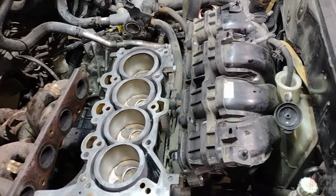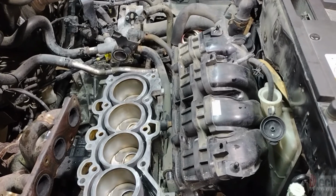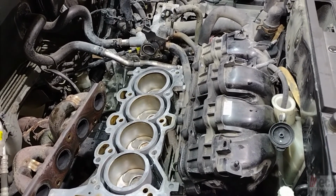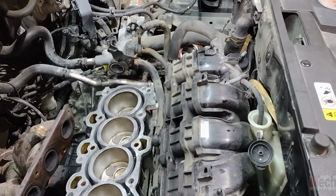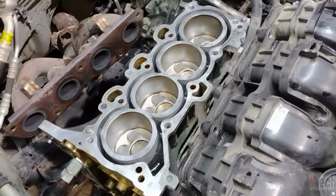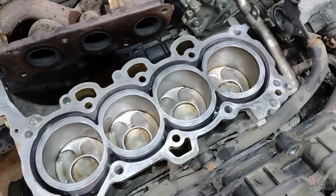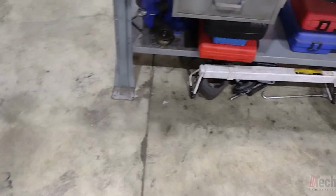Being that we didn't see anything on the intake valve in the intake manifold pattern, and we didn't see anything in the crankcase, and yes, it can go into the coolant system, but being that they drove this here from their location and it did not overheat, there's no signs of coolant spewing, and I can grab the coolant hoses and kind of squeeze them. They're not overpressurized. I can probably assume it's not going into the cylinder coolant jacket. All that is pretty much left